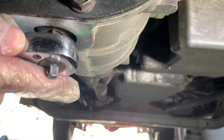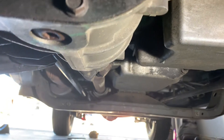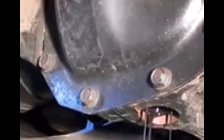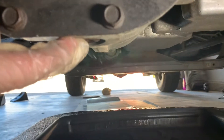Okay, now we're ready to drain. Grab a 3/8 ratchet — all it takes is the head of the 3/8 ratchet and you can loosen it up. Remove the drain plug and again, make sure the gasket comes off and you get it clean. Let it drain. When it's all drained and you get the gasket clean and the plug wiped down, reinstall the drain plug and the gasket.